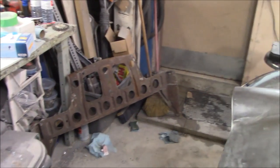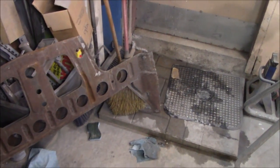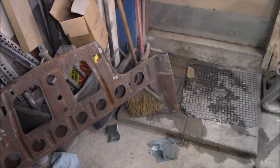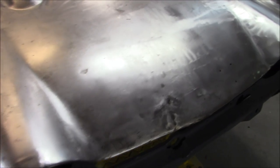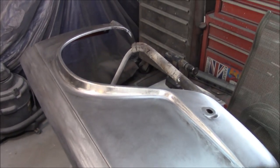I had mentioned we were thinking about working on the inner bonnet structure. We're going to glass bead blast it, but I might want to give it a head start with a wire brush and an angle grinder before the bead blasting stage to make things quicker. I'm going to cover the car up with some plastic because when I start grinding that rust it's going to go everywhere, and rust particles on bare metal will cause surface rust faster. That's the plan — next up is the inner bonnet structure.